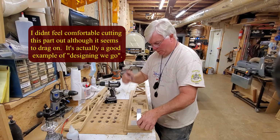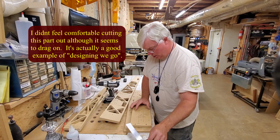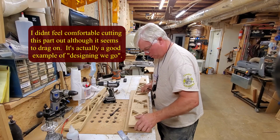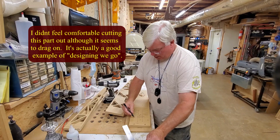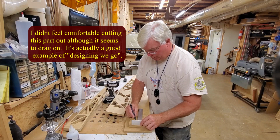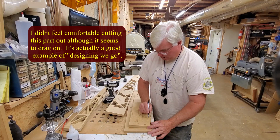Right in here. So pull our doubler out and see where we can do that. So mark the lightning hole that we are taking out. This one here. We do intend to take that one. So our lightning hole could come right in here somewhere. Want to leave enough room for the aluminum there. So we could come right in here and give ourselves a lightning hole and essentially do the same thing down here on the bottom side.